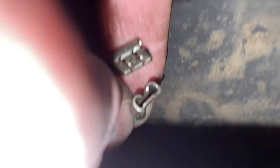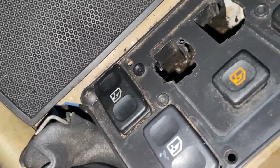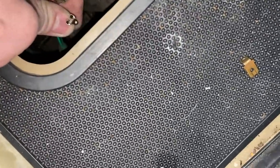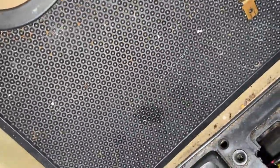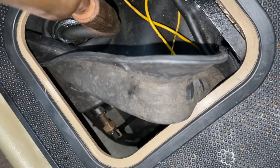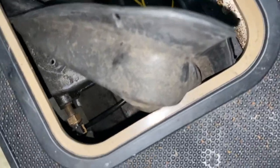I actually unplugged my lights. I have the two cables for that. To fix not having reverse lights right now, what I'm going to do is run a wire extension from here into one of these holes. Then I'm going to run a switch to it. But first I'm going to make sure that will work, because these wires are way too short. I do not have a soldering iron right now. The problem too is that connector is not working — if I put it in reverse and take it out of reverse, it's not turning the lights on and off like it should. My guess is it's just a button in there that activates the lights.